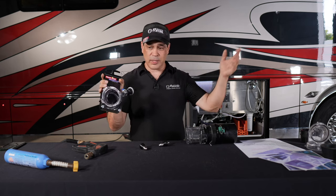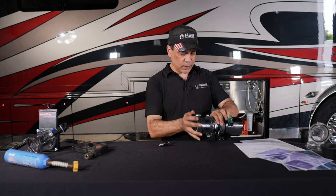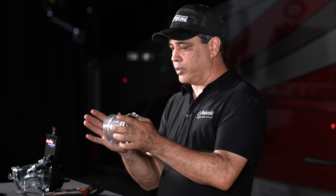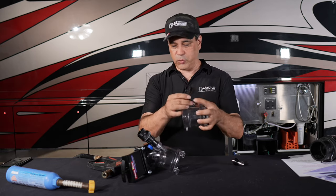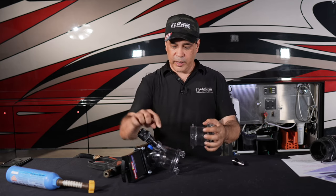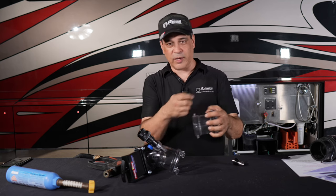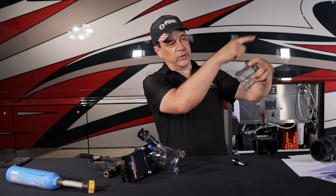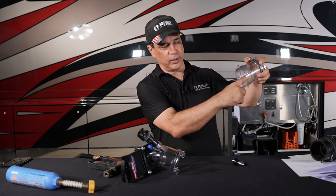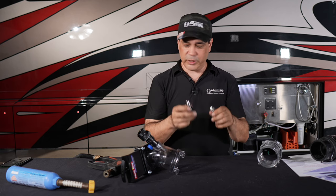Here's another example of the adapter that goes up into your tank, and all the high pressure from the power washer built into this coach will clean that tank out. That's about as good as you're going to get — that's the ultimate way. After that, you go back with the hose, wash it, fill it up, and wash it a couple more times. Typically you can use an adapter — they make a longer clear one where you can drill a hole so the power washer hose can get up inside. Same concept: hole goes in, you pull the hose back and forth. You can put a rag around it since the water just flows out the bottom as you're flushing the tank. By far the absolute ultimate way to wash it.